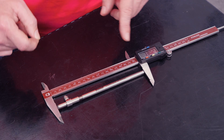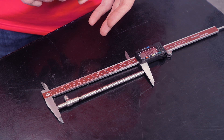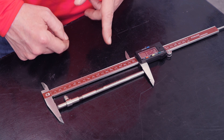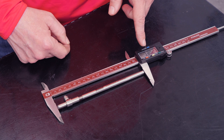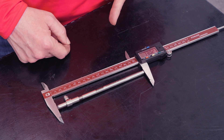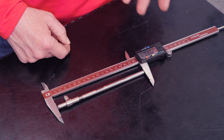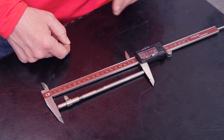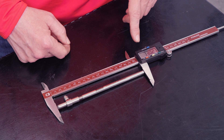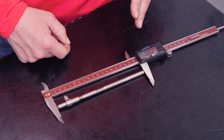The measurement is 7.302 to 7.3025 inches - that's the actual push rod length to zero lash with this particular lifter. A short travel lifter may have only 30 to 50 thousandths of travel, in which case you'd add about 25 thousandths, giving you a 7.325 push rod. An LS7 Delphi lifter has 166 thousandths of travel, so you'd want 50 to 75 thousandths minimum preload, meaning a 7.375 to 7.400 push rod.